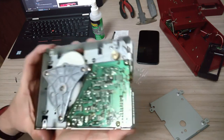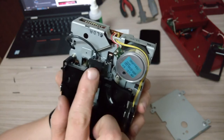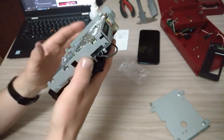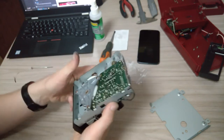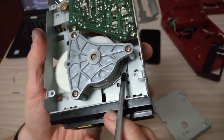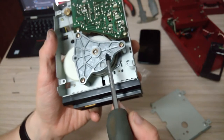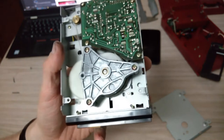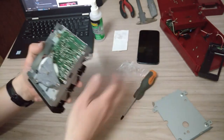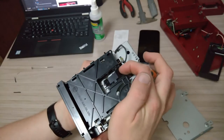The first time I put this circuit board back on, I noticed this sliding bit wasn't going all the way back to press this switch. It was kind of just stopping there. I was trying to work out why and looking at the photos in the instructions, and that's when I noticed this bottom plate here — it had rotated 90 degrees as I had taken this top bracket off. So I managed to get it back around to where it's supposed to be, and that seems to be all back together now properly, sliding forward and back to hit both switches.